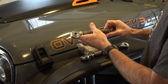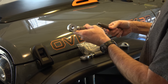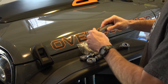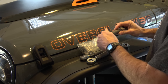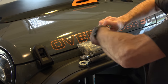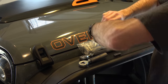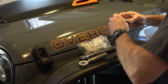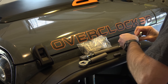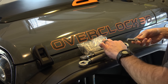Next, we're going to move to the links. These links are pretty cool, pretty heavy duty, and actually come with a variety of options. There are three separate link tubes that you then put together with studs to match whatever length you need. I went ahead and pre-installed these, including with the jam nuts, just to get a test fit. Now I'm uninstalling them partly to show you but partly to further prepare them — I want to use an anti-seize product on all of the connection points just to keep them from corrosion-locking together.